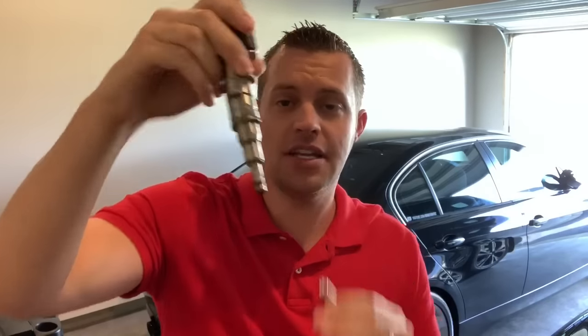First, a clogged injector. When you're running your engine, carbon deposit buildup is all internal. When your engine starts cooling down, those carbon deposits stick to things. With direct injection, the injector is on top of the piston area and gets a lot of carbon buildup sitting on the tip. A clogged injector causes misfires, messes up the fuel spray pattern, and gives you rough idle and hesitation on cold and warm starts. Eventually you'll need to replace your injectors, mostly because they also have an internal filter inside that gets clogged too.